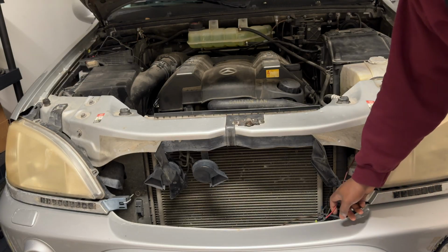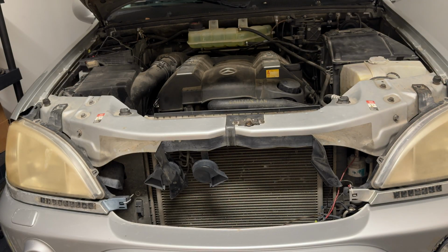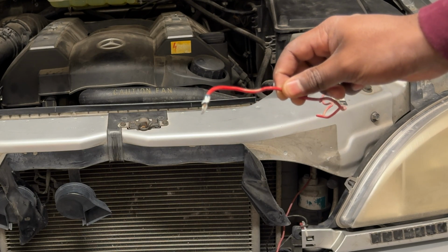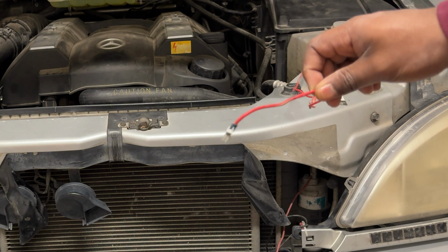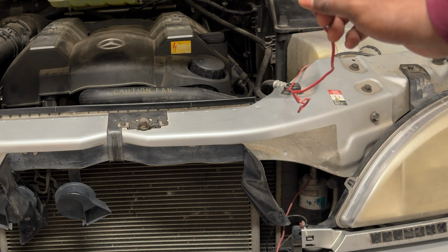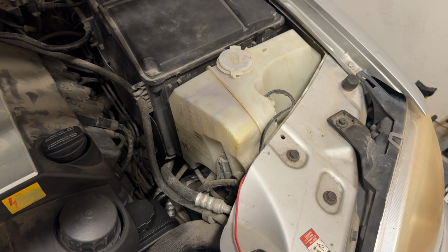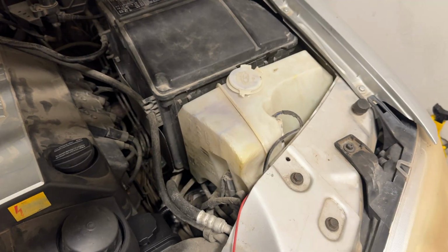We're just gonna ignore this very suspicious looking, terrible harness for the daytime running lights this previous owner installed because it looks quite janky. And also, if you guys saw how it was wired in the fuse box, you'd be terrified. This wire right here was pretty much going directly into the fuse box. There was no fuse attached, just this. So that was really nice and safe. We're definitely gonna get rid of this. Well, that's a very crunchy looking washer fluid tank. That'll certainly need to be changed because that looks like it's gonna fall apart any second now.